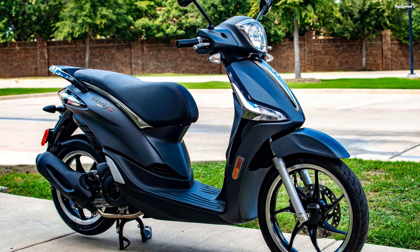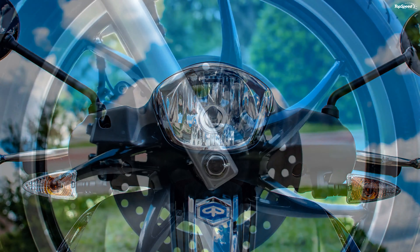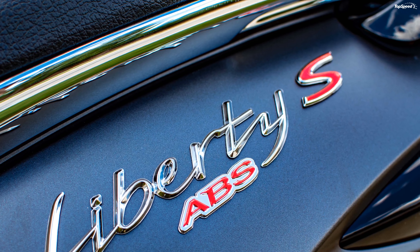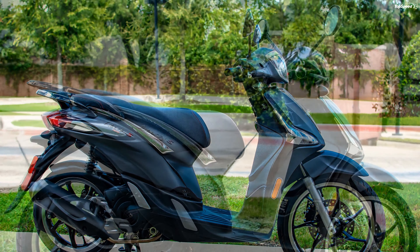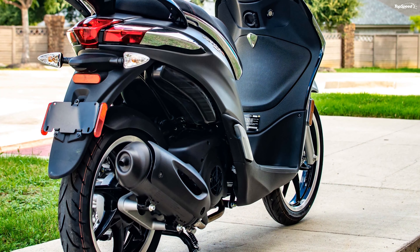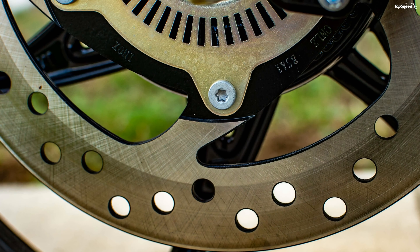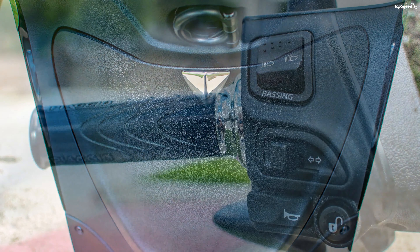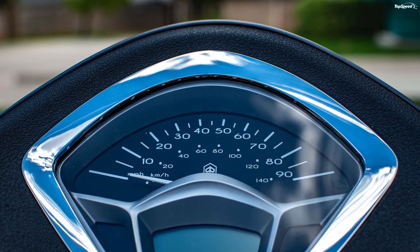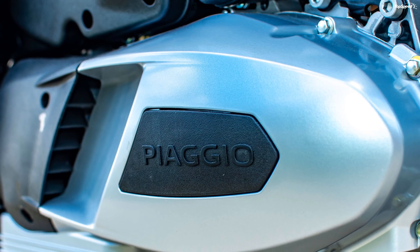Piaggio graced the Liberty family with a 14-inch rear wheel and 16-inch front, so it handles more motorcycle-like than one might expect. Like so many other features on the Liberty, the single-cradle underframe is completely new — tubular steel members for the main structure with pressed sheet metal reinforcement — resulting in a stiffer frame with better handling than the previous generation. There's a slight variation in rear suspension between the 50 and 150: both run vanilla front forks and a preload-adjustable monoshock, but the 150 gets 2.93 inches of travel at the rear axle where the 50 gets 2.89 inches. Both run a 240mm disc and twin-pot caliper up front with a 140mm drum brake out back, but the 150 models alone get Bosch ABS support for the front brake as standard equipment.